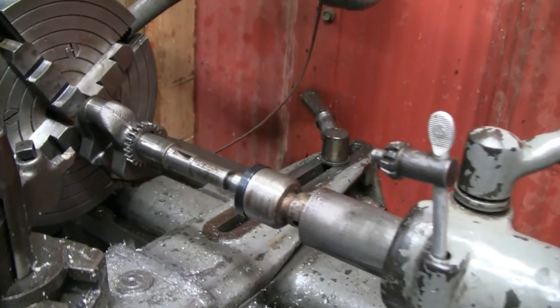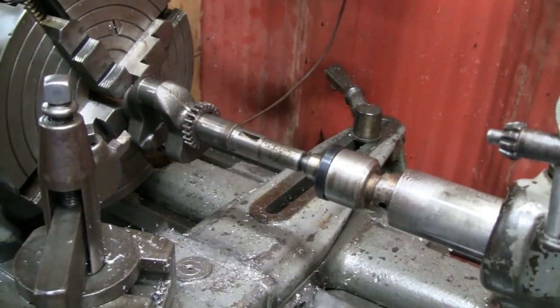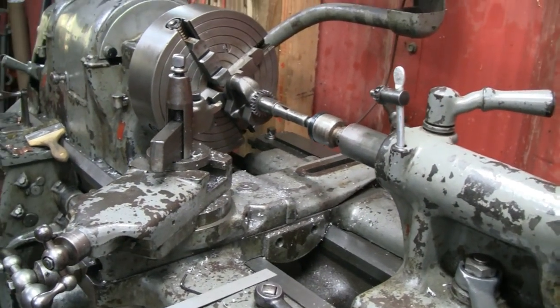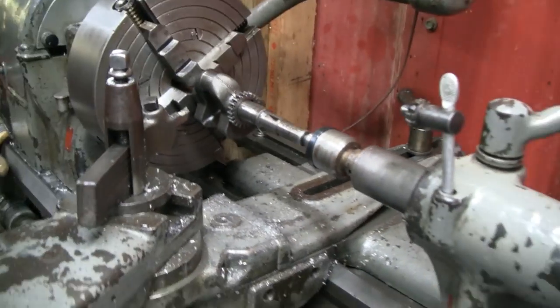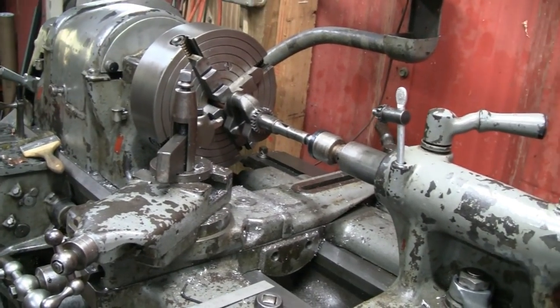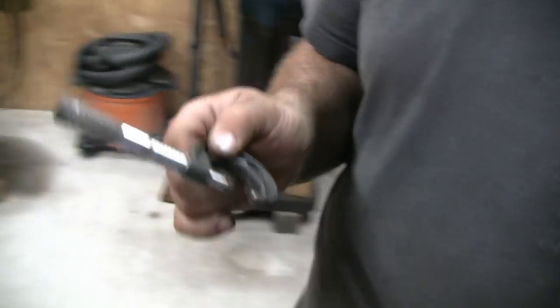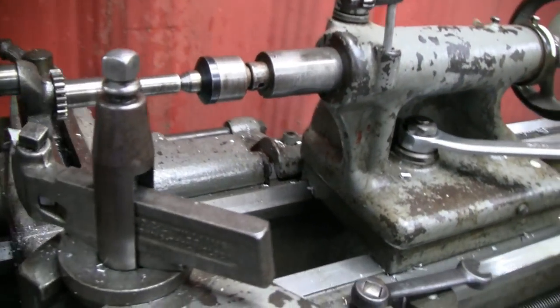The crank is in there and we're all chucked up. Mike is just getting the mic. How's it looking? It looks great. It'll look better once you cut it. Alright, so we've got to take 62 thousandths off of it. That step is 687 thousandths.